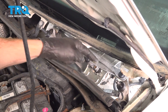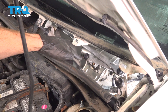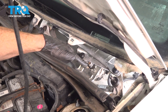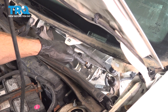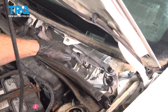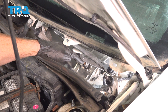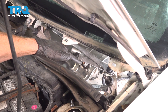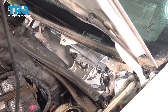Now that we have that out of the way, we have a nice clear view of our wiper transmission area. The next thing we need to do is move along to the center nut here. This nut holds the regulator to the motor shaft. We can't really access it from this position, so make your way safely into the passenger compartment, put the key in the on position, and turn on your wiper motor. We're looking to get this up and out of the way. Once you have it in the proper position, go ahead and turn off the key.